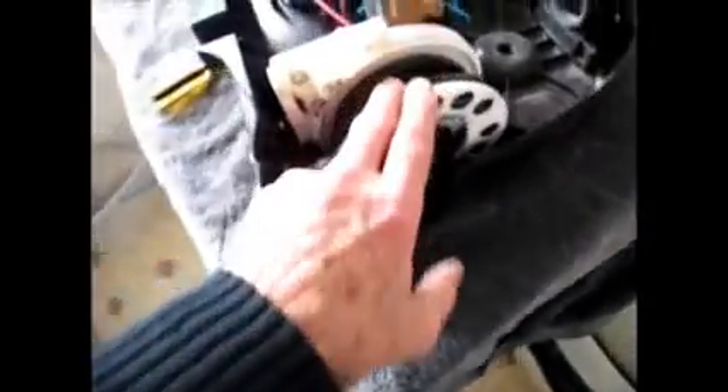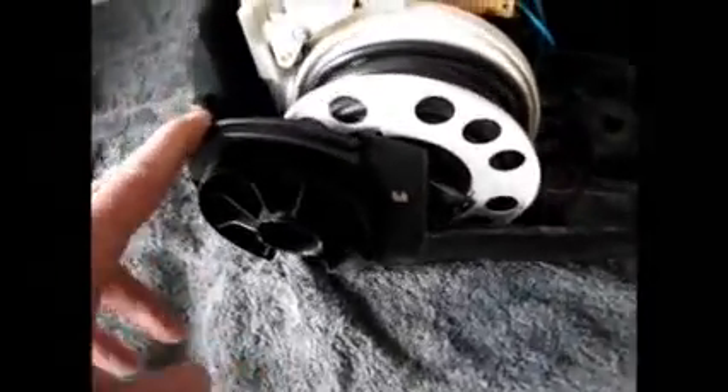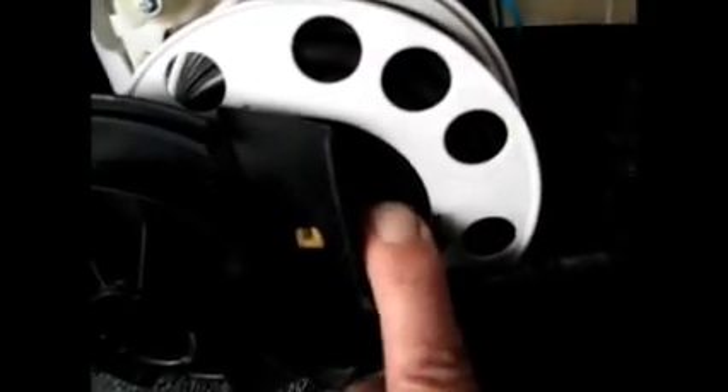Now you can get to the recoil if you need to replace your lead - if it's got damage and it needs replacing. We'll just have a look at that recoil now and how it works. There's a coil spring inside - to show you how it works - it's like the sort of spring you'll find in clockwork. So there we have a coiled spring. It's already under tension, so don't go trying to just yank this out because it'll spring all over the place.